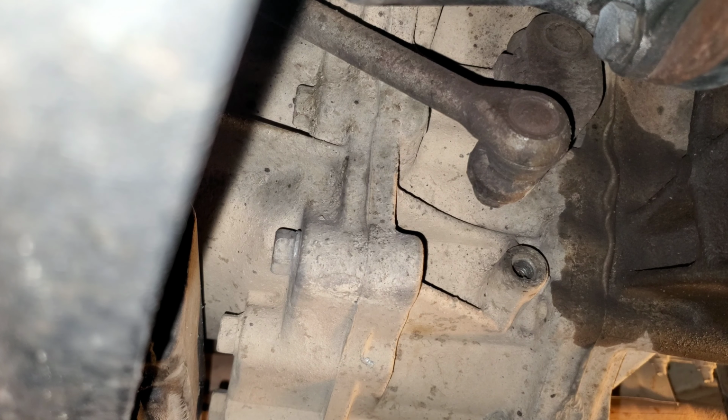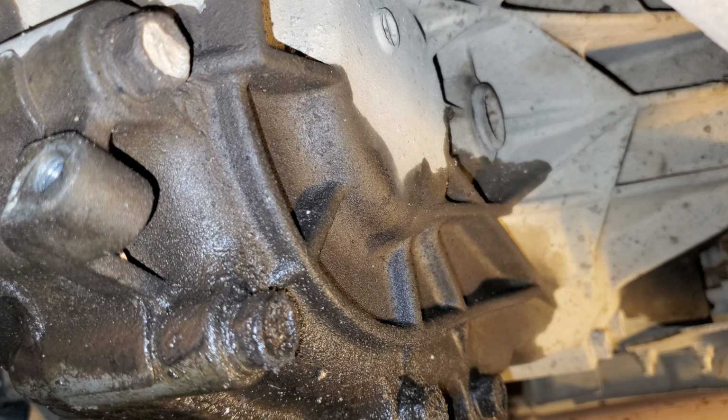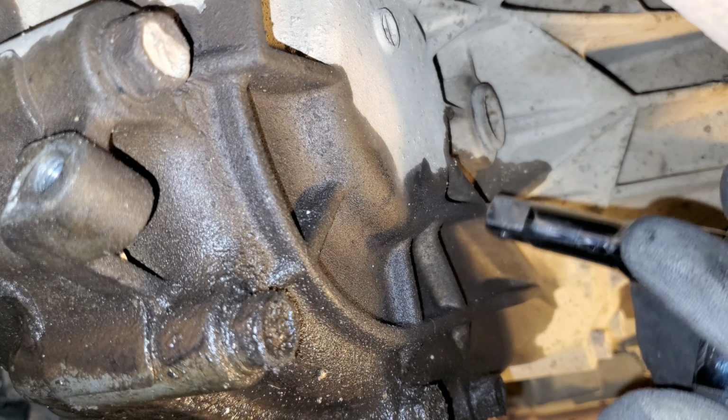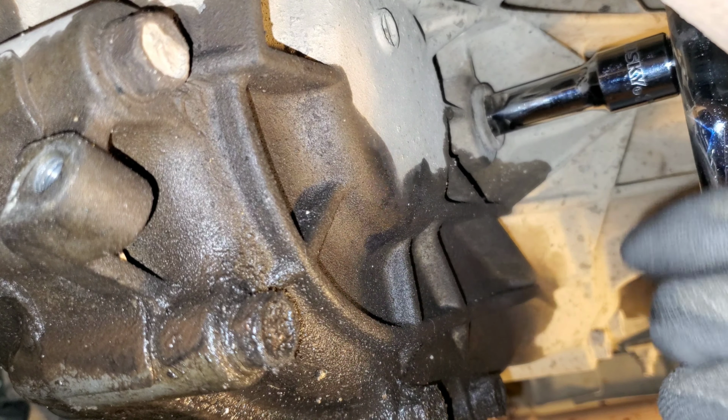Next, we're gonna go ahead and open our fill plug first. All right guys, so here's our fill plug. This is gonna take a half inch extension, so I'm gonna go ahead and grab one now. I don't expect there to be any debris in this one, but just in case, I'm gonna bring along a flathead screwdriver. Yeah, I don't see any debris